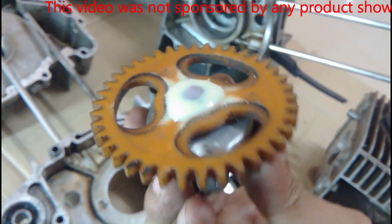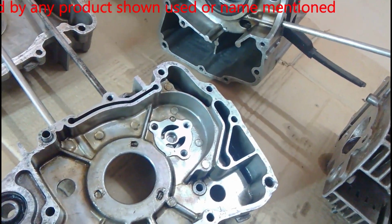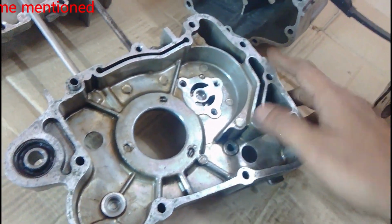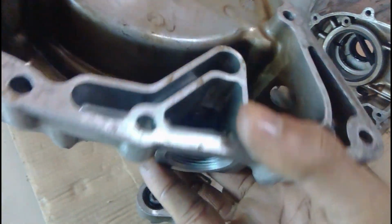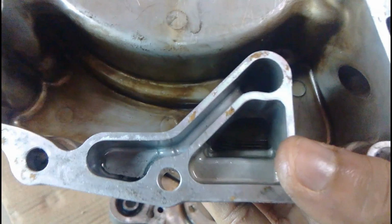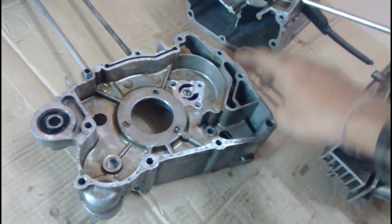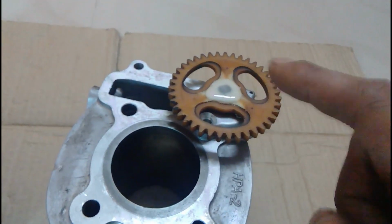I wonder why the company makes this pinion out of plastic, because maybe if the pump gets blocked, the pinion can break open without damaging any other components, maybe that's why they make it with PVC. I hope this pinion gear works. Plus I need to fabricate an oil strainer here. I have an idea of making an oil strainer from a wire mesh gasket that I have found from a microwave magnetron.